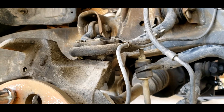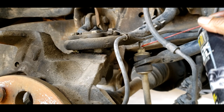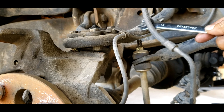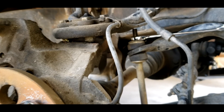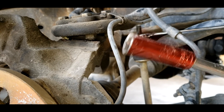In order to get this sway bar end link off, the first step to make life easier — a little bit of that. Because there's a lot of stuff in the way and the end of this is pretty much on top of the upper A-arm, I'm just going to use an open end 14 to hold it from the top and then use this deep socket 14 and twist it from the bottom.